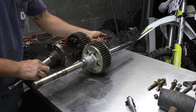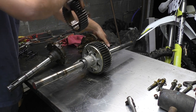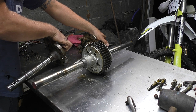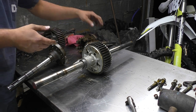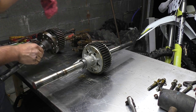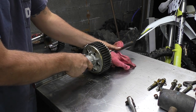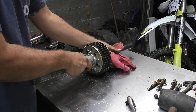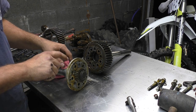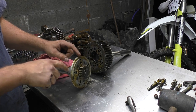There it is — it just looks like a typical 633A transaxle. If you wanted to you could do the gear flip situation, but I'm going to be welding it up. The cast iron one is the most common diff for one of these wheel horse axles. Then we'll pull the aluminum one apart — this is a 10-pinion and it is a limited slip. The last one I did had a cast iron housing; this one has aluminum.